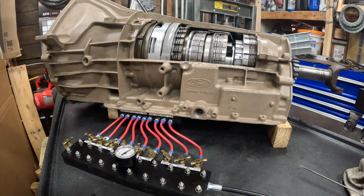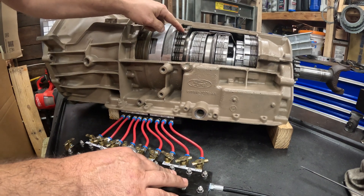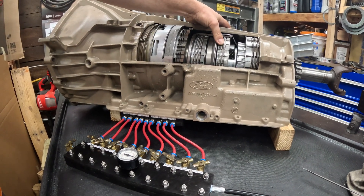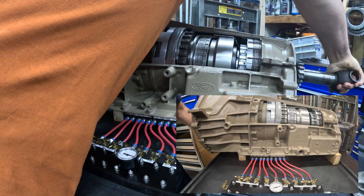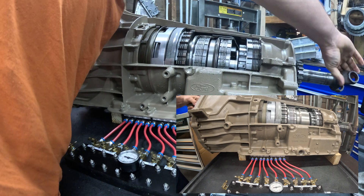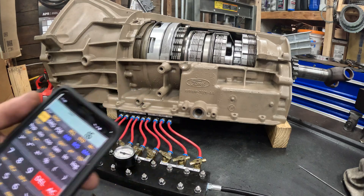I got it reset — tick mark is back on top, crank is at the bottom. Now we're going to apply the forward drum again and the intermediate. There it goes — intermediates locked, forward's locked, everything else is unlocked. This is second gear. One revolution on second — I got almost 12 teeth, we'll call it 11 and a quarter. Our expected on this is 1.54, I get 1.6 — close enough.